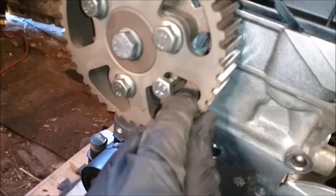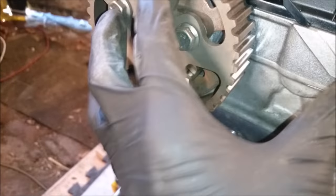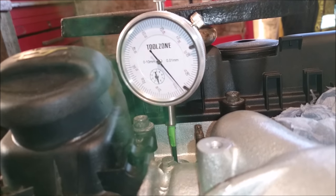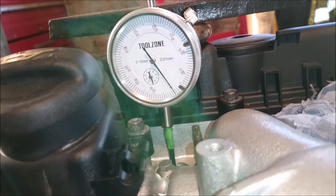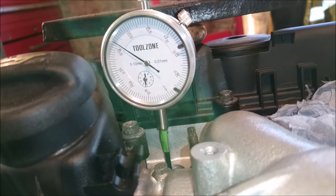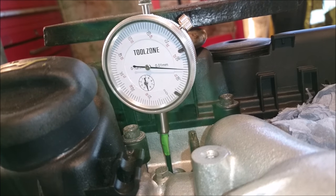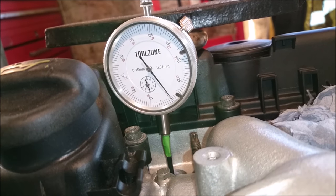So basically: dial gauge on cylinder number one, cam on the usual timing pin - that's normal. This is free on these three bolts here to allow for the slack and slop, but both cams are in place. Then we use a spanner and very gently move it - the dial gauge moves. I've got it centred on zero so that when it goes to zero, we're there. I'll back off the piston a little bit - I'm rotating - just applying gentle pressure. The dial gauge is very accurate; well, my cheap one isn't that accurate, but it's accurate enough for this.